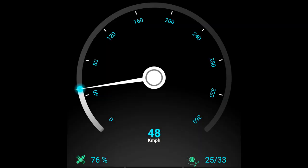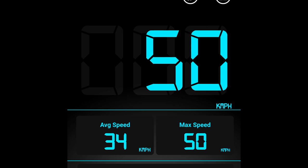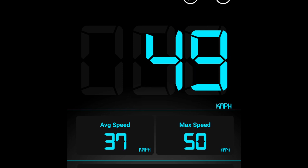I did two tests, first speed and second the odometer. If you take out one bulb, the speedo will still work well as the base frequency from the speed sensor remains the same, but the odometer literally counts pulses, so it will not work accurately.